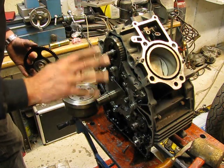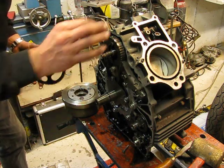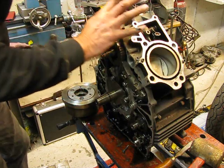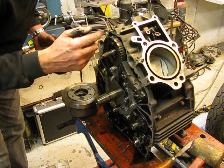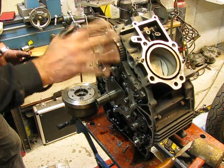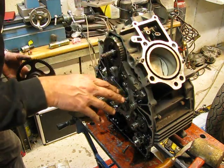Normally all bolts stay here for 30 years and I take them out easily. Only stainless steel bolts — that's a bit different story. I don't want to use stainless steel bolts on these engines because the tension and force of the bolt is different than the original one. So I use only steel bolts from Honda or a different brand — standard 8.8.